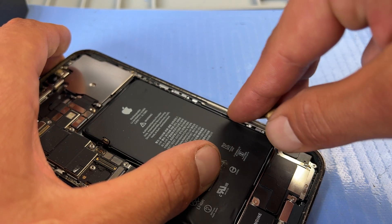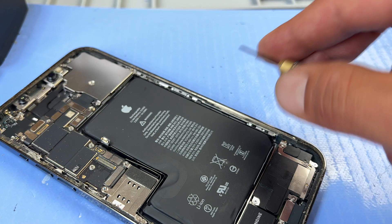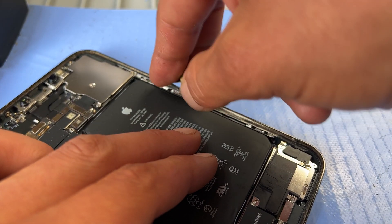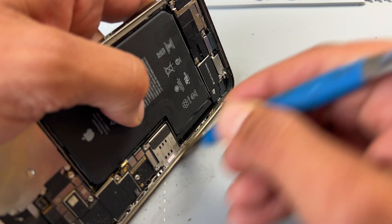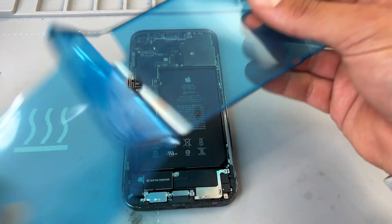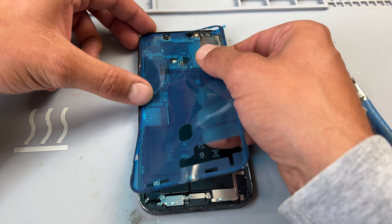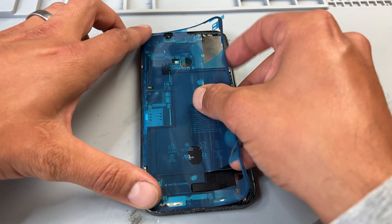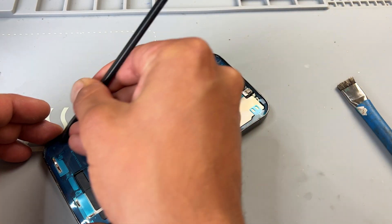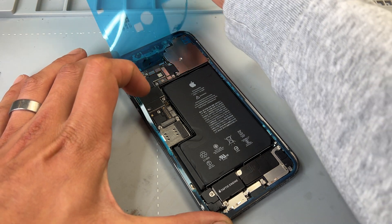Because we've opened the device I will remove the adhesive seal from the edges so that I can replace it with a new one. The glue on this model is particularly stubborn and I find it's removed best with one of these small scrapey, chisely, scalpel-y tools. Once the thick of the glue has been removed, take a small brush and remove any leftover adhesive with some isopropyl alcohol. Now we can take the new seal, peel off the first film, and I always start in the left hand corner, followed by lining up the left hand edge — if everything's in line with that, the rest of the seal will follow in alignment. Use a plastic spudger to make sure it's pressed down right into the edge and sticks down well. You can now peel back the first layer of the blue film, leaving the thin blue layer behind until we come to seal the device.